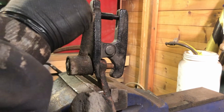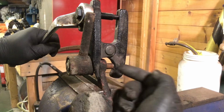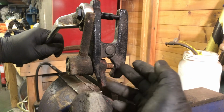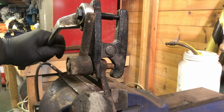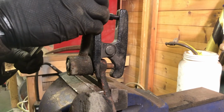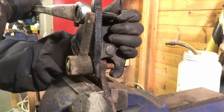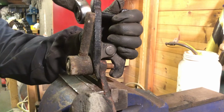Now, what does tend to happen is that this builds up a lot of force, basically. It does it by slightly stretching the bolt as that pushes in, or I suppose it's actually compressing this bolt, and when enough force builds up, that will shoot off, and probably the whole lot of it will end up on the floor because it breaks all of a sudden and releases the force. So let's have a look, see how many turns it takes. The other one took about 4 or 5 turns to get it off. You just never know. But obviously stay out of the way of it, because when it does release, see, that's obviously building up force now.